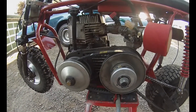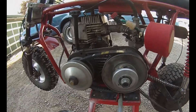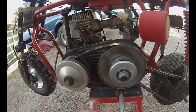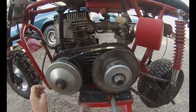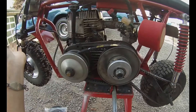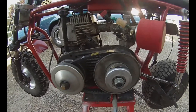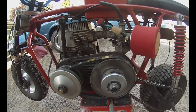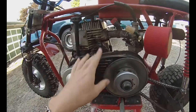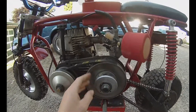It's almost like driving an automatic car stuck in first gear — you have to really rev it out and then it shifts right over. When you're giving it full throttle it's fine, but if you're just cruising it'll want to stay in the lower ratio unless you're at a higher speed. However, it's a lot better for wheelies. Before, I could barely wheelie — it would just slip the belt. Now with a combination of a new belt and more torque from moving the spring over, it's a lot easier — you almost have to watch out.